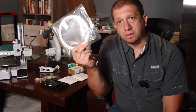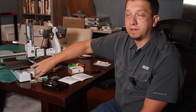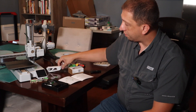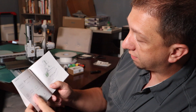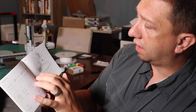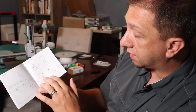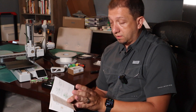Now I've got to put stuff together. There are several screws and bolts because we've got the actual A1 Mini itself. We've got to follow the instruction book: attach the spool holder, unlock the arm by unscrewing some bolts, screw down the bed to secure it after transit, and install the cutter and purge wiper onto the printer. I'm going to time-lapse that for you — it's actually pretty quick. I also need to put some bolts on the bottom of the AMS and connect all the PTFE tubes.